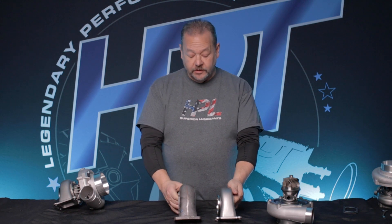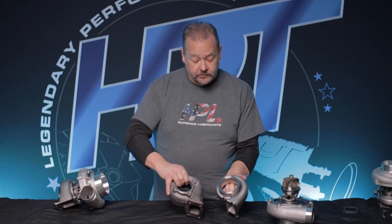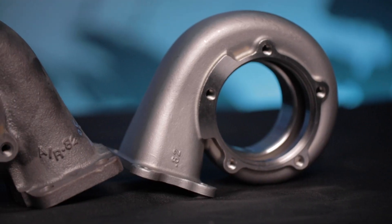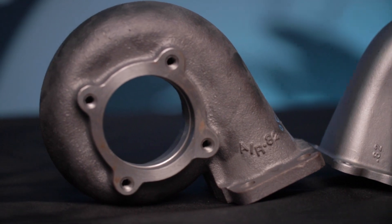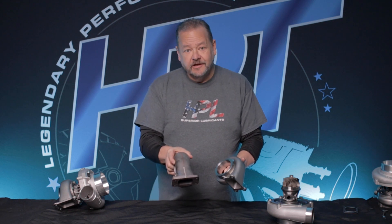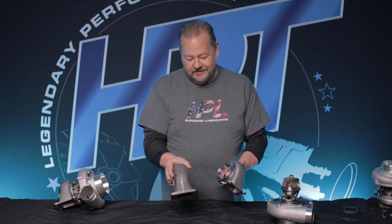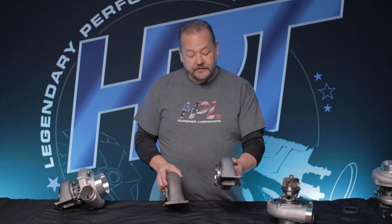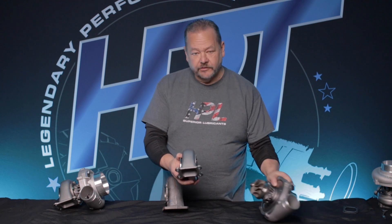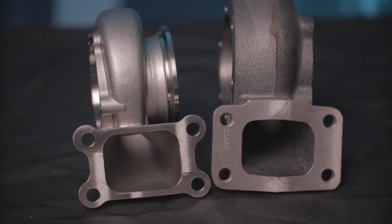In comparison, this is what an iron 82 housing looks like compared to a stainless steel housing. It looks significantly smaller, but that's because you're really seeing what the inside of the iron housing would look like without the added material that adds weight and mass. Also, when it cools down, it heat soaks back into the turbocharger — iron is a really good thermal heat sink. So when you get it hot, eventually it's going to cool down and transfer back into the turbo. Not so much with the stainless, because it doesn't have as much BTU capacity as iron. Overall, when we shut down the turbocharger, less heat goes into it, so another benefit is less under-the-hood temperature after shutdown.